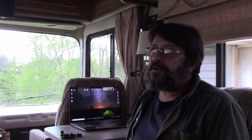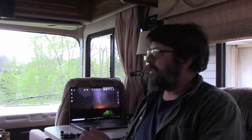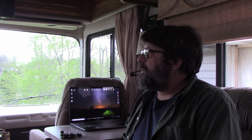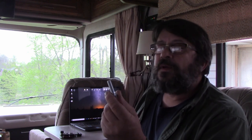Okay, so the exhaust manifolds, got them back together. I started up, it was quiet. I let the engine warm up to operating temperature, let it run a good 15 minutes. It got really warm. I let it cool down overnight, and I retorqued them bolts one more time, and that's it. We've driven around a bit, and it is so quiet. It is so nice.